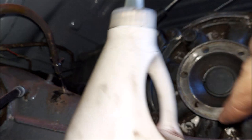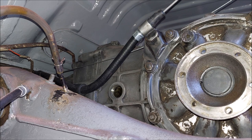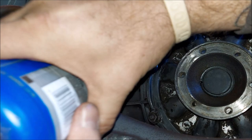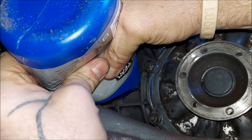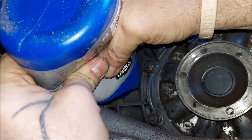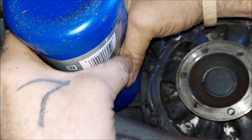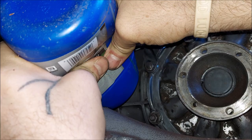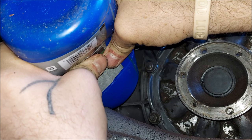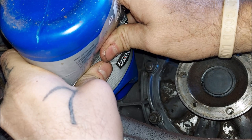Okay, this one wasn't full — it was sitting on my bench. So let's get another one. Make sure your car's level, by the way — should have told you that. Make sure it's sitting on level ground. Don't have the back end in the air and the front end on the ground, because if you do that you're not going to get a proper level reading and it'll all be tilted forward. Get the car up in the air safely with jack stands and keep it level. They sell some pretty unique packages now instead of bottles, where you can squeeze the package up inside of there instead of fighting with a bottle like I'm doing right now.